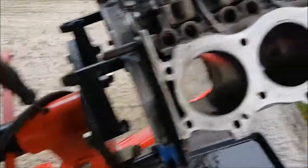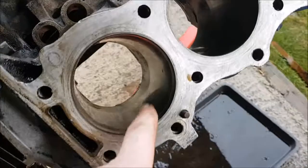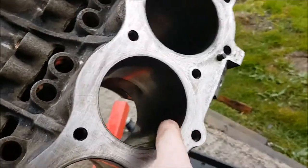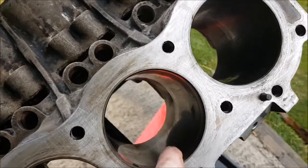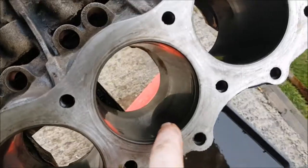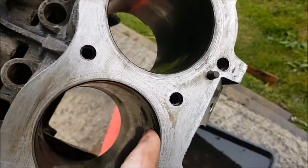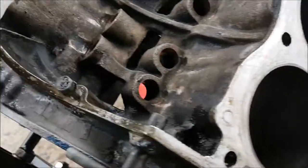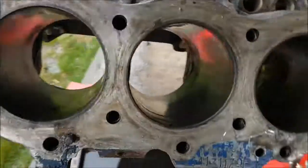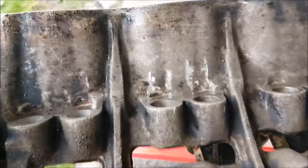Let me tip the engine up the other way. I've just swiveled it around - these engine hoist things are bloody brilliant. This cylinder also has a tide mark, as does this one. You can't really see them because I've wiped oil down the bores now to protect them. These cylinders have a very very slight lip at the top. I suspect a hone would get it out, but I'm going to measure the bores and find out. It's not a huge issue - if I have to bore the cylinders out I've got to get a new set of pistons anyway, so it's just the cost of boring out really.